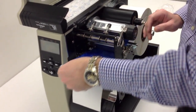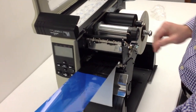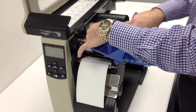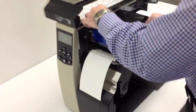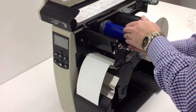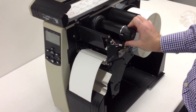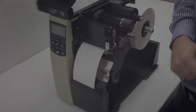Pull that out and I would pull out just a little excess. Halfway close the print head. With the flanges open on the ribbon take-up spindle, you're going to go underneath and wrap that around. I generally go around about six to seven times, just until it grabs itself — and you'll see it grab itself. Close up the head, and you're ready to go.